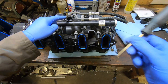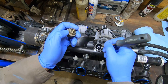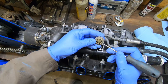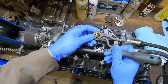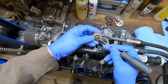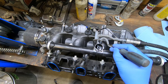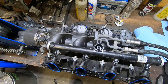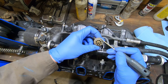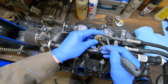The fuel that comes out that center hole goes down and connects into the return line. For my purpose, if I can eliminate that diaphragm so fuel flows freely through and out here, that should work — because the external regulator will be downstream and will control the pressure. I'm going to try to disassemble this regulator without completely destroying it.